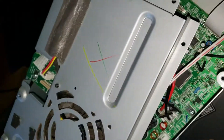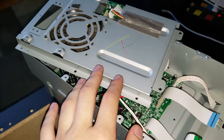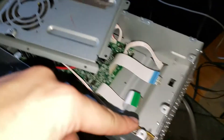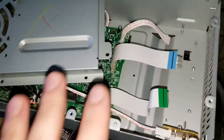When you do that, the entire controller box should slide out the bottom. Then, assuming you want to get at most of the controller circuit boards and not the power supply, you'll undo the screws around the edges as well as one at the top, two at the bottom. You'll probably want to undo the two connecting the two plates on the back, and then they'll come apart.